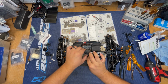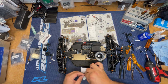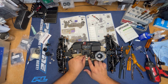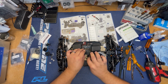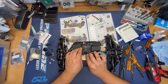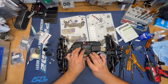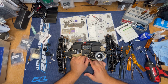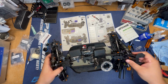We're going to go back here. We're going to check. Back with another piece of paper, just to see that nothing's changed once the engine is down in place. So, paper goes through, doesn't rip in any way, and you've got just that nice amount of play. Also, just move it around, check it everywhere, and same thing you should have when you're setting, I can't really show you the clutch, but when the clutch is set up, you should have about 0.2 mil play back and forth, front to back on the clutch belt. Okay.